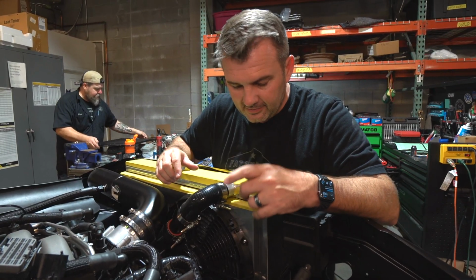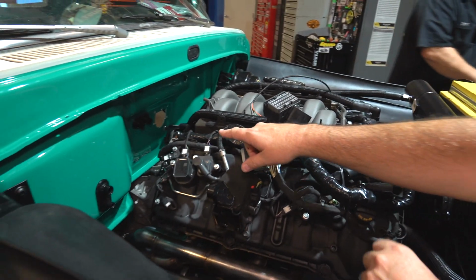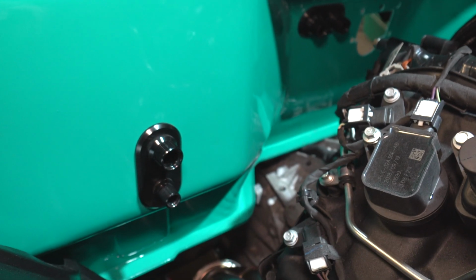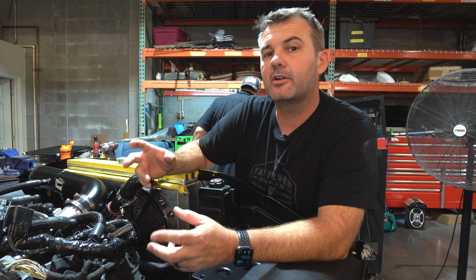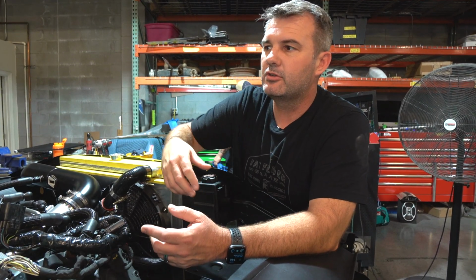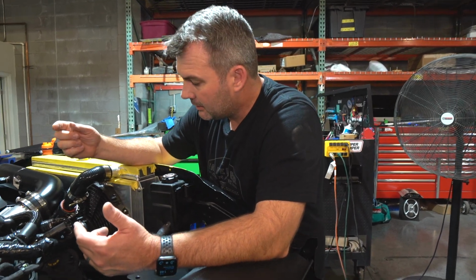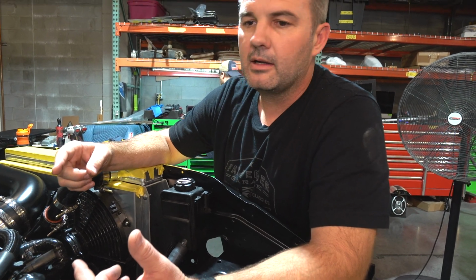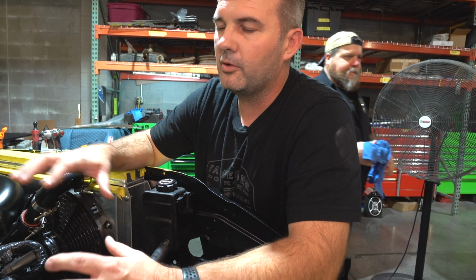We'll be running the AC lines. Right back here in the top, you'll see the heater lines will go in there and the 2 AC lines here. Rather than having them all go in one big mess in one spot, it's a little easier under the dash if they go in 2 different spots, and a little cleaner. We'll install an H-pipe in this as well for the heater core. When we bypass that, we won't lose our coolant on both sides of the motor.